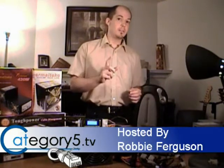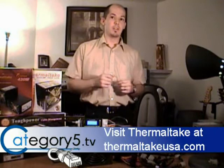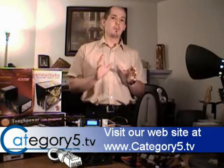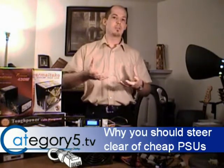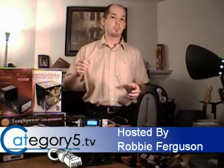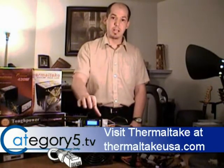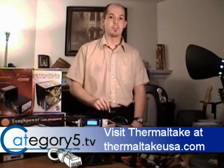Not until then will your power supply automatically, using the PG value, send a signal to the computer to fire it up. So that's why with a higher end power supply, sometimes you push the power button and it seems to take a split second before it fires up — whereas with a low end power supply, it's going to just turn on right away. The problem with that is it takes a moment for those capacitors and transformers to create clean power. So if the power supply allows the computer to come on immediately, that's going to be driving dirty power into your computer system. The Thermaltake power supply with the clean PG value shows that it waits to fire up the system until it is generating clean power.